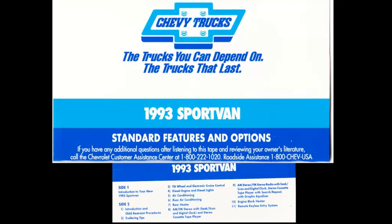To help you enhance the future performance and economy of your Sport Van, let's go over a few tips to follow during a break-in period. First, we recommend that you limit your speed during the first 500 miles to a maximum of 55 miles per hour, and be sure to vary your speed during this break-in period. This procedure allows many of the engine components to seat correctly for future performance. Second, avoid full throttle starts and, whenever possible, hard stops, especially during the first 200 miles of driving.